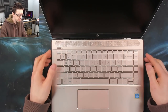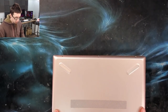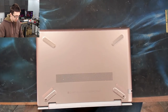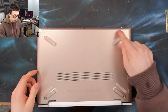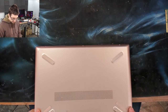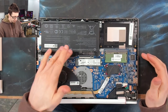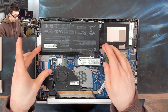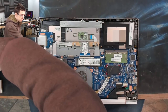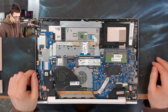It appears we've got a memory error, so I've already had the back cover off this. I'll show you — I'm just hanging the display off the back so I can easily flip it over. There are three screws along the front and two hidden under the feet. I'll take that cover back off. The first thing you want to do is take the screws out from around the battery, disconnect the battery, and just leave the laptop for a couple of minutes — two to five minutes, it doesn't need to be very long.